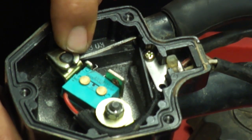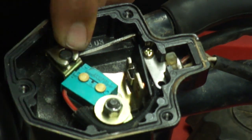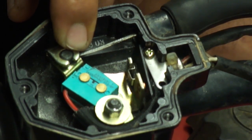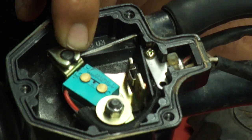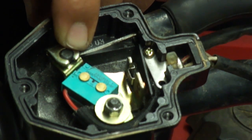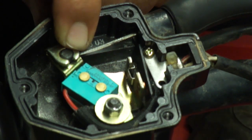So when the cable sticks and you let go of the throttle, it releases that micro switch, which triggers the speed limiter to limit the RPMs of the engine to about a thousand, maybe 1200 RPMs. Because this thing is an automatic CVT, there's no way to disengage the power from the engine to the rear wheels, and this is your only safety for that because there's no clutch.